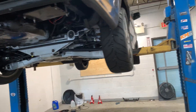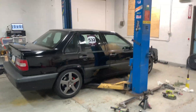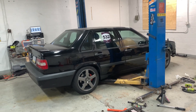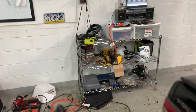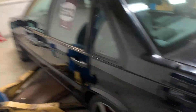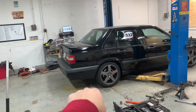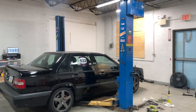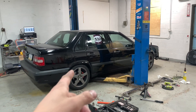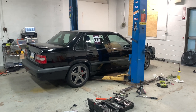I've got a used known good working viscous coupler coming. It's just going to take some time to tune everything. I finally fixed the traction issue — the rear suspension helped a lot, but it was actually an issue in the tune. The engine was cutting out without throwing any check engine lights; the oil pressure was just barely flickering at the minimum threshold and triggering it. I fixed all that and now it just pulls right to 8500 RPM. Oh my god, it is fast in second gear — totally four-wheel drive. It really grips once the tires warm up.